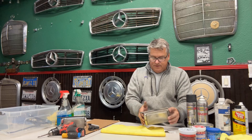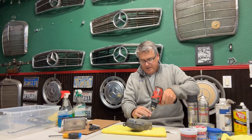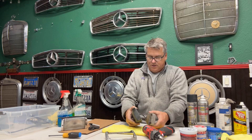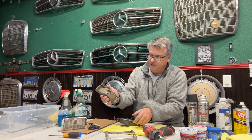So the first thing we do — this is going to be on your car. I'm assuming you don't want to remove it. I had to cut the wires from the door; it's from a junkyard. So you remove the two screws and you've got to separate the glass. Sometimes that's a little more difficult. Now these two just unplugged — that one just unplugs and this one unplugs from the glass here.